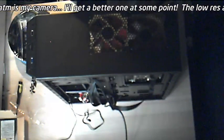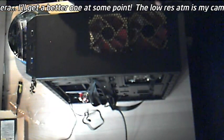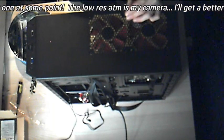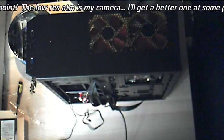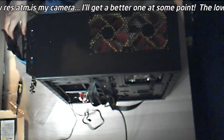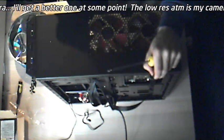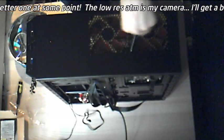So, if you notice, I'm also doing the cabling so that every single fan that goes in has the same cabling direction when it's in a certain place, and that's just to aid the cable management, because trust me, when you're working on a PC and the cable management is just literally everywhere and all the cables are still hanging out and getting in the way of fans, I get absolutely fuming. The first thing I do when I see someone's custom built computer, if it's in a mess, I always redo the cable management and clean it up, make it look pretty, even if there's going to be a side panel, because doing that you get better airflow. Always look for airflow over where the heck this cable's gonna go.